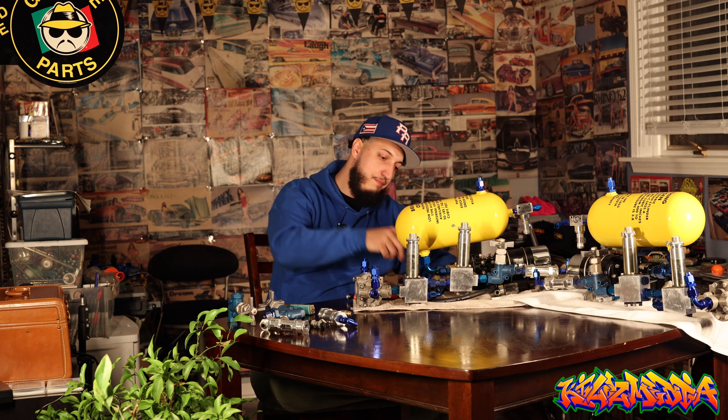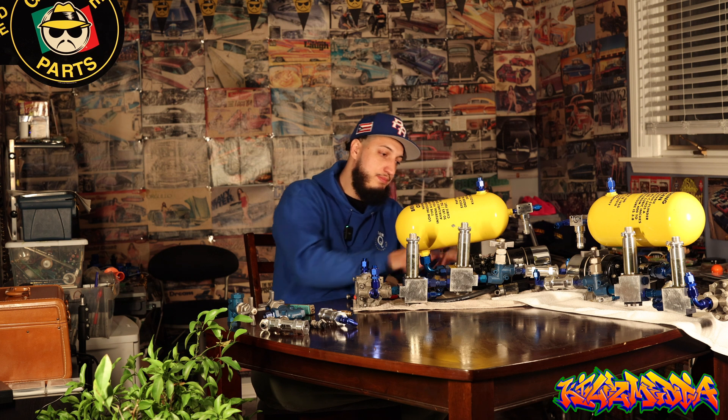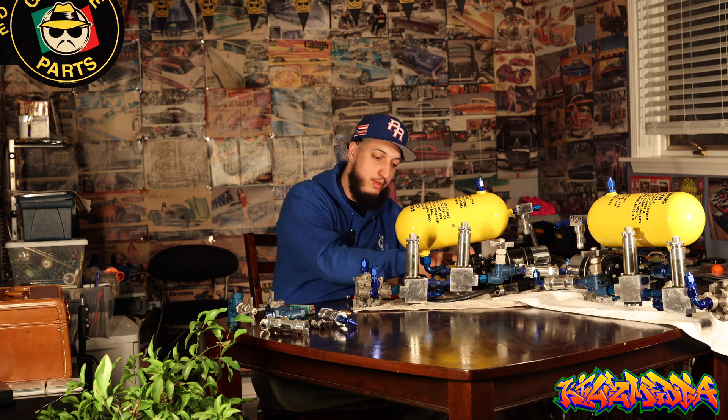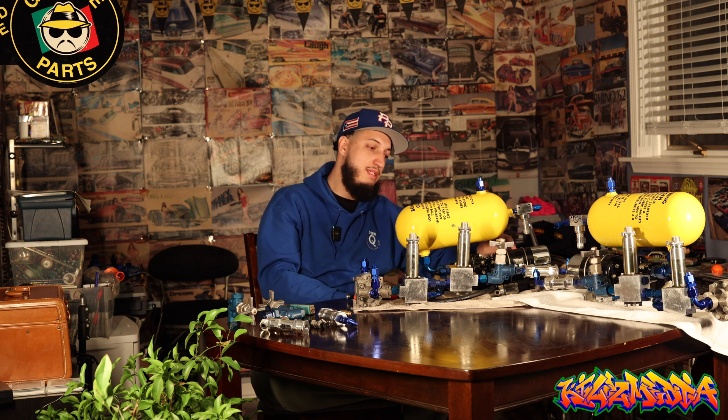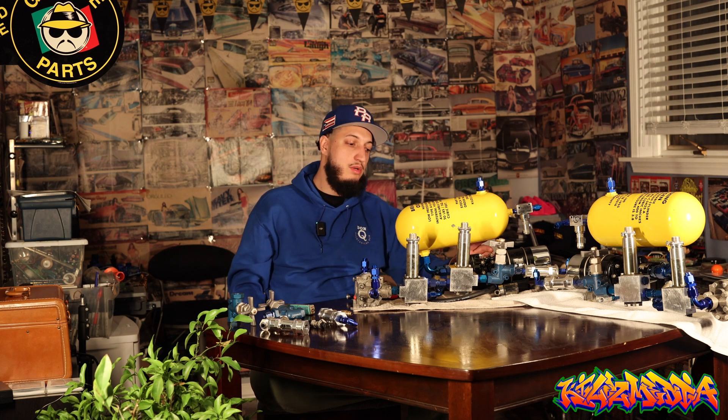There are a couple different variants. These are actually made in Aurora, Ohio — they still make them there but you have to do huge bulk quantity purchases. They also do a lot of reproductions, so keep your eye out. The OG ones have two popular variations: the common one has a line down the middle, and another one has more lines. This feeds through to the pump head. The pump head on all Pescos except roosters is three-quarter inch; roosters are one inch.